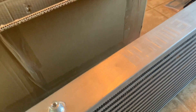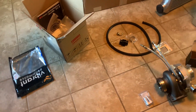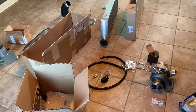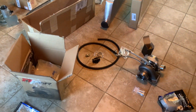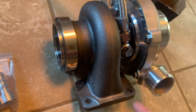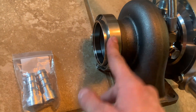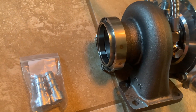For the fuel pump — I don't have it over here but I do have one already. It's a Walbro Hellcat 450. I'll be running stock lines, stock fuel regulator, and stock fuel filter — I may just freshen it all up, but for my power goal there's really no reason to change any of that. This turbo uses a V-band 3-inch exhaust housing, which is great because I can make a 3-inch downpipe. It's a V-band unlike the CX Racing turbo with the four flange bolts that's a nightmare to get to.